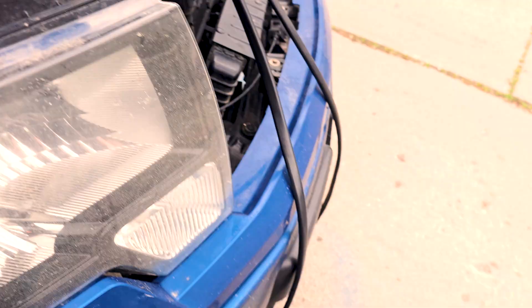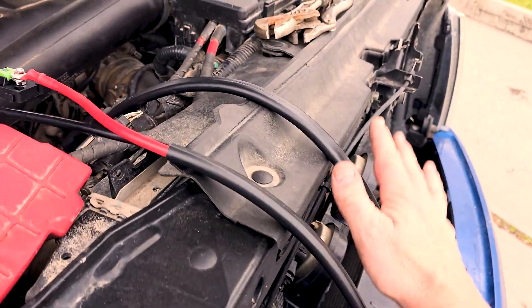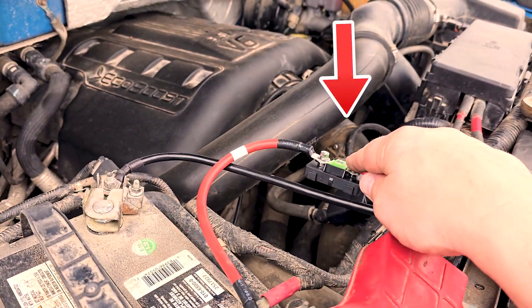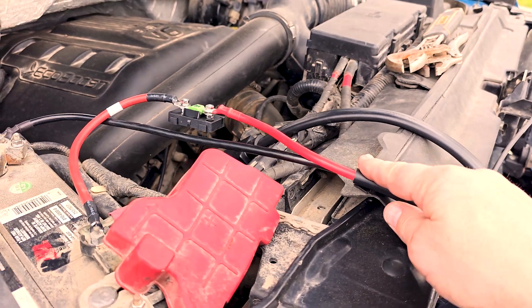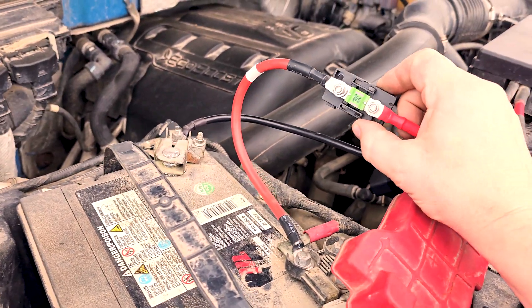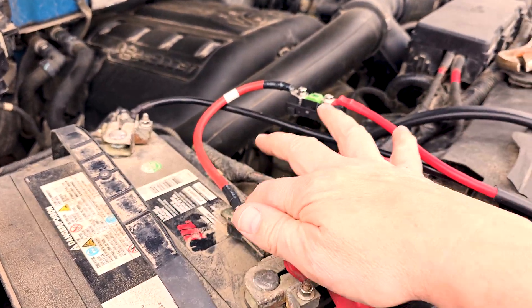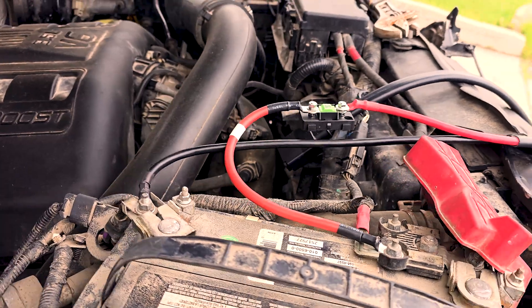For the red wire, you're going to want to make sure to use the included fuse. It comes with a 125-amp fuse. This is important because due to the length of this wire, if there was a short anywhere, you want this fuse to blow long before the wire completely melts and burns up.